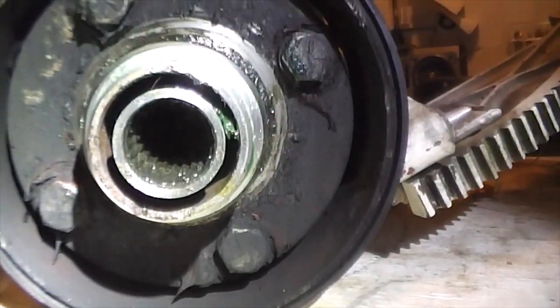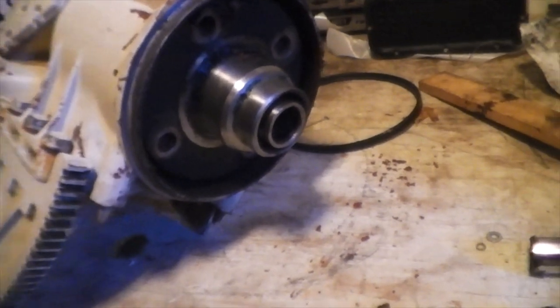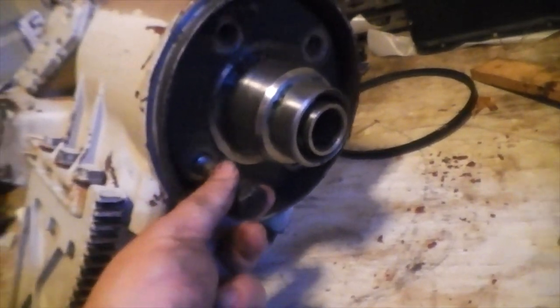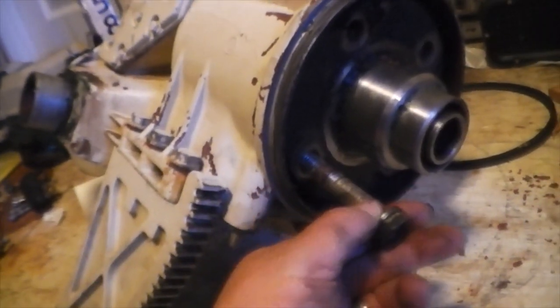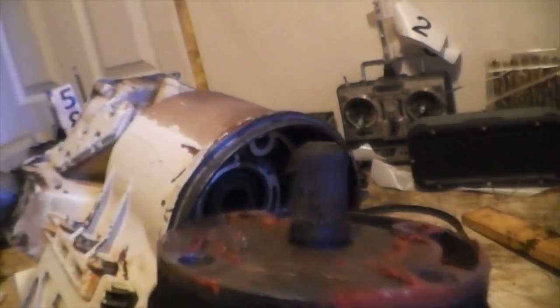To get the water pump out there are four bolts at the bottom — take those out. It's probably going to be full of Make-A-Gasket. When you split these two there is a gasket or bushing that goes on top of where the swivel is, so make sure you notice that when you take yours apart. I had to take a rubber mallet and tap it because that shaft is a little dirty. This is the water pump — we'll get it split apart and rebuild it.